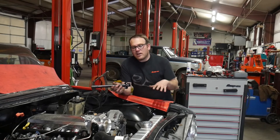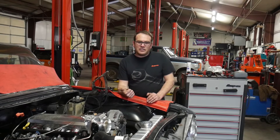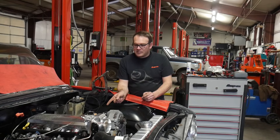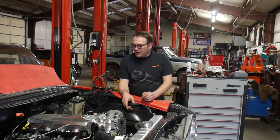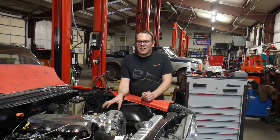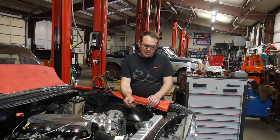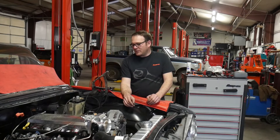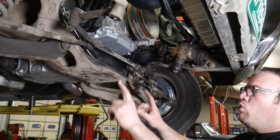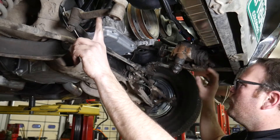Let's go ahead and start taking off all the old stuff. We're going to pull the steering linkage and the gear, and we're also going to have to pull this steering shaft out. There's no slip section in this steering shaft, so it's really kind of hard to get this shaft out without loosening up the gear. I'm going to start from the bottom and pull the gear out, then get the shaft out and put the new stuff in. We're replacing the center link, the idler arm, the pitman arm, and the gearbox.